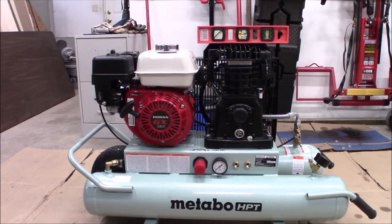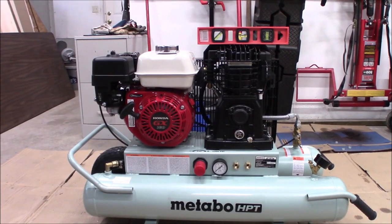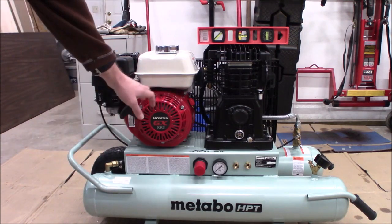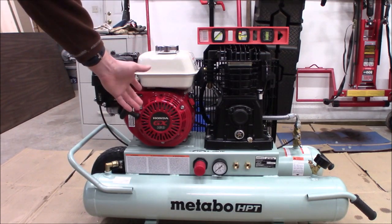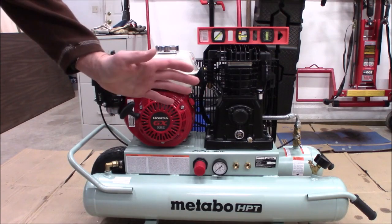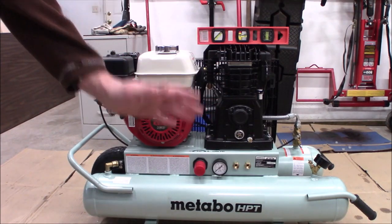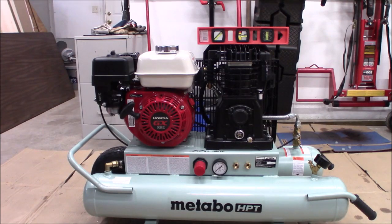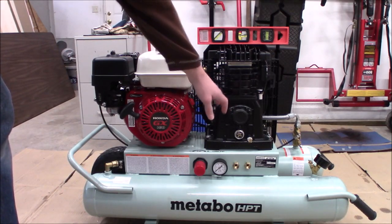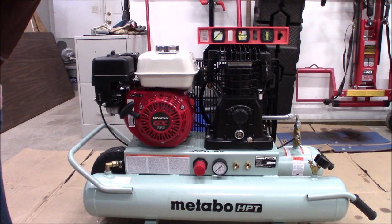The next big thing is operating conditions. It needs to be on a near-level surface, as level as possible. You can get away with a few degrees of tilt or inclination — engine manufacturers do publish this for each engine. Remember, all these small engines, whether it's a lawn mower or anything — until you get up to a large enough engine with an oil filter, they do not actually have an oil pump. They've just got a little splasher in there. So if you get an uneven surface, you'll get oil rolled off to one side and won't get enough lubrication throughout the engine, which will cause engine problems.